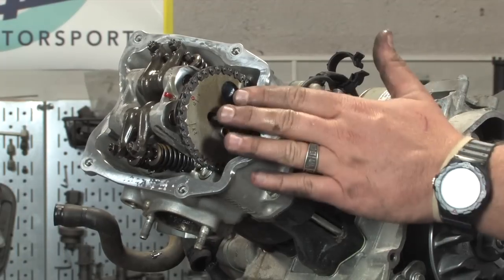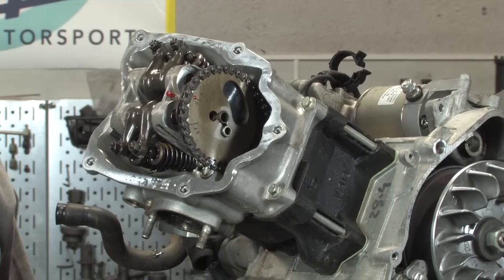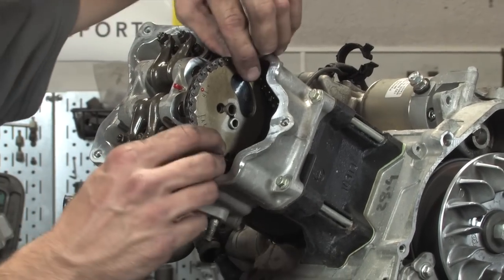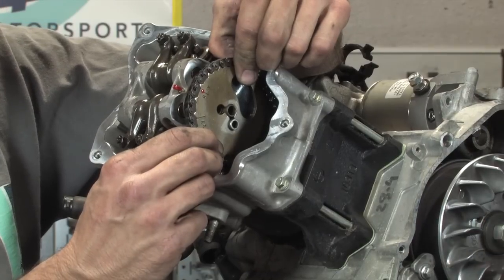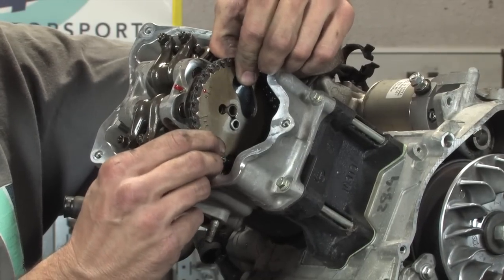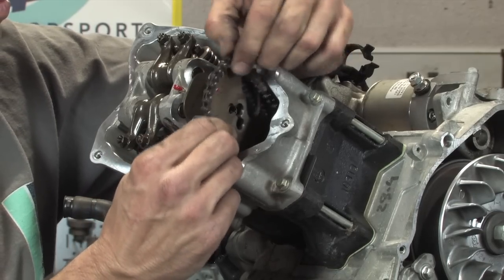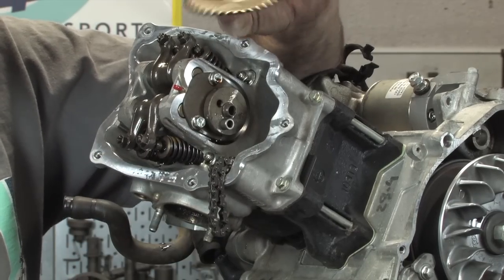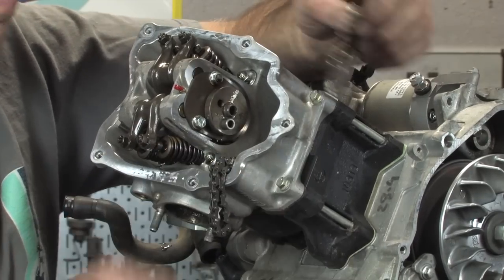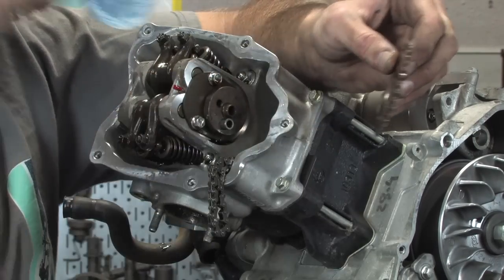How often would you need to replace like the cam sprockets? Virtually never, unless you had some sort of damage. So again, in the case of this motor, we did note that we kind of filled the crankcase with water. That kind of stuff wouldn't potentially damage this stuff, maybe if it was done excessively. But for the most part, if you do it one time, even all these components are still reusable. Yeah, these metal components tend to survive just fine.